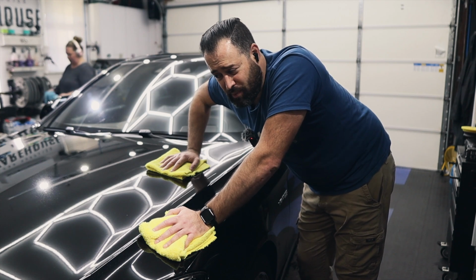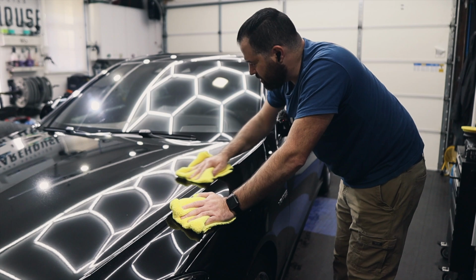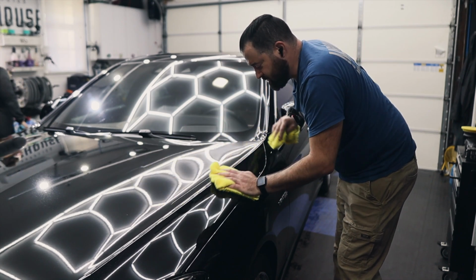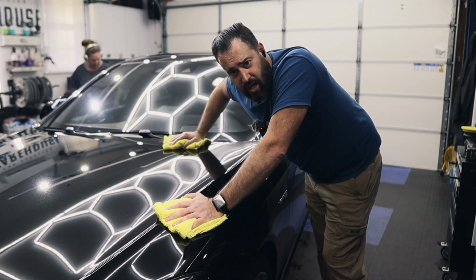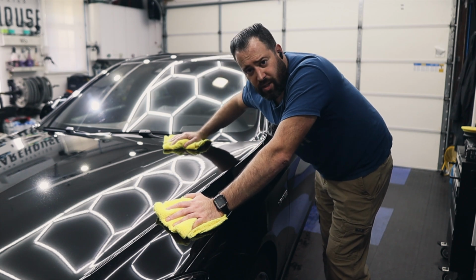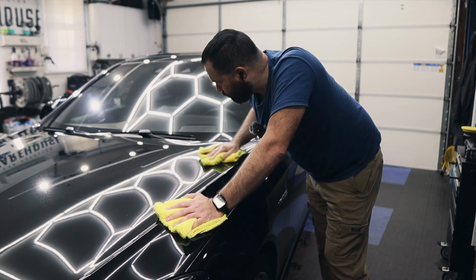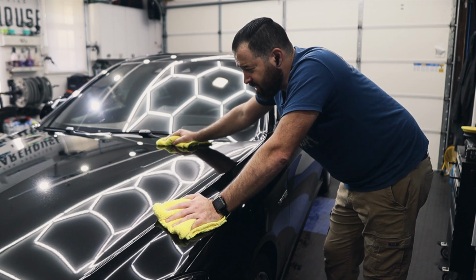So some people still cross-hatch, and that's fine. That's just their system of how they do things. But it's certainly not something that, if you don't do it, it's going to show in your results. It's really not. Cross-hatching is just to get 100% coverage, but you can get 100% coverage by going in the same direction a few times and just overlapping. That's why you may see us not really cross-hatch. We just go in one direction and that's it.